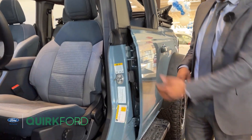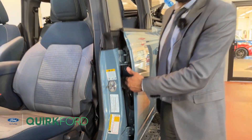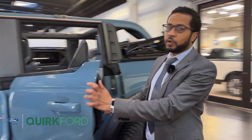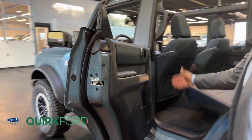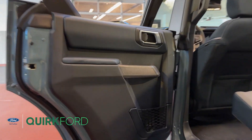It's often tempting to attempt to remove the rear door from here, but it's not advised. Even though it's fully exposed, it's not the right way to go about it. Open the door to the open position first, then disconnect the electronics, remove the upper and lower bolt, and take the door right off.